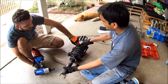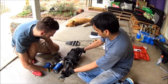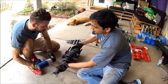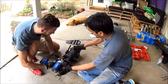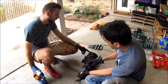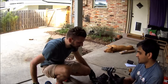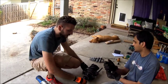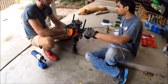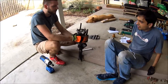Basically, what you're looking for is when the top spring part breaks away from the top hat — then it's loose. You can see it separated from the bottom there, so it's got a little wiggle. You can go tighter if you want, but as long as it's loose on there it should be good to go. Now we have the spring compressors on there — treat this carefully because it's like a loaded bomb, basically.